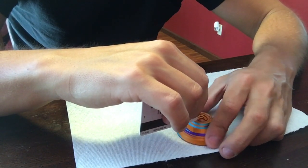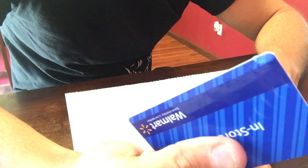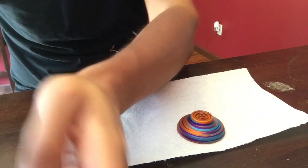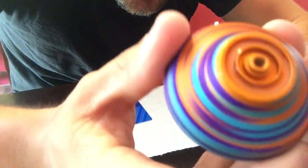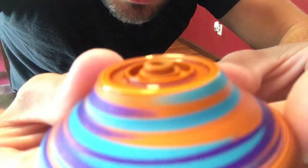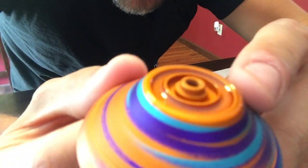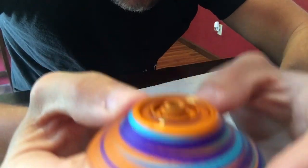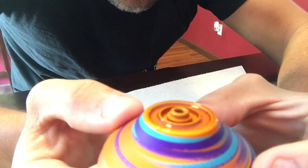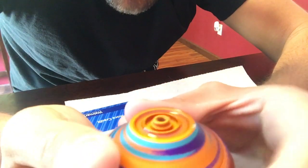The second one was pretty much perfect, but I'll give you a close-up on this one. See, you'll scoop that up. We got the silicone on that. Make sure you have an extra paper towel to clean up your credit card between halves that you're sliding. And if we can get it to focus, but you can see here on this side, you definitely can see. Wish I had a better camera for you guys, but you can see that the silicone was pushed off the edge. So that's what needs to dry, and then you can peel it off. But, like I said, once it's dry, it's super easy to peel off. As you can see, the groove is perfect after you run that credit card across it.